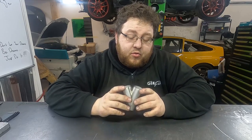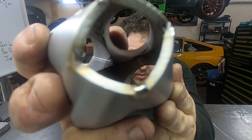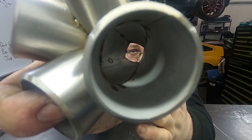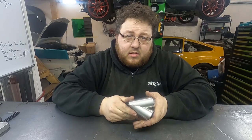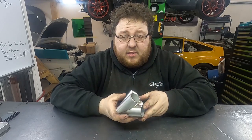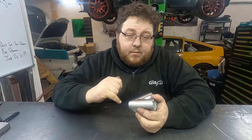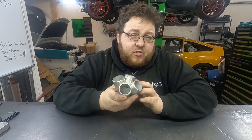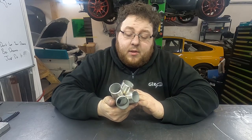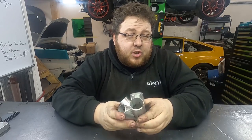That's the merge collector all tacked up — really happy with how it's come out. All the gaps have closed up nicely. The next step is to cut the collector down to the required flange size, whether it be a Garrett GT, T2, T3, TF035, TD05, or whatever. Then we weld the inside, weld the outside, and finally weld it to the flange. If you're interested to see what manifold we use this collector for, click the video card — we're building a Colt CZT TF035 stock-location tubular manifold and this is the exact collector we're using.